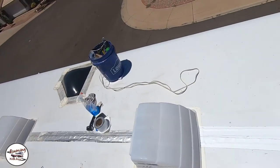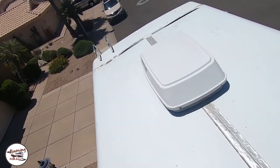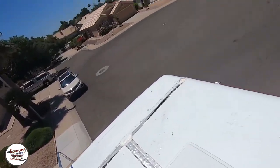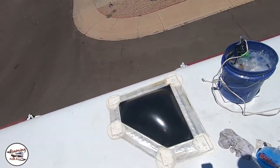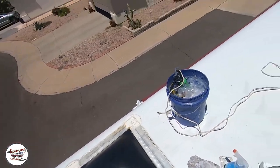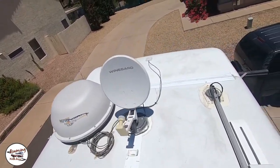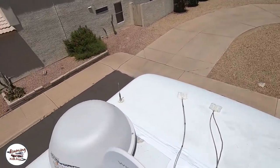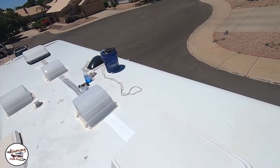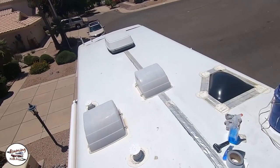This is about mid-stream of the coach. I still have this long run, this long run, this short run in the back here, and then that long run in the back to do. And if I have enough, I'm going to redo around the shower because I don't want any leaks. Everything else looks really good. On the edges — like over here on the edge — I'm going to put lap sealant, and in the corners and on the edges, just for that extra protection. Maybe a little overkill, but I'd rather have some overkill than a leaky roof, because the leaky roof is going to cost you a lot more money.